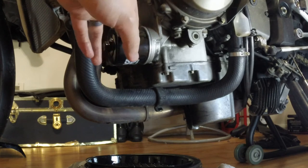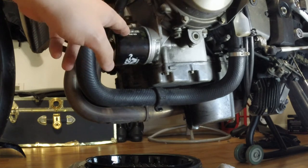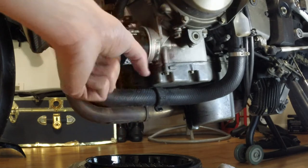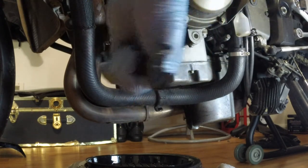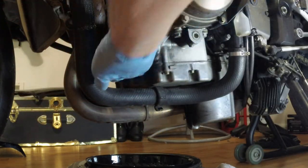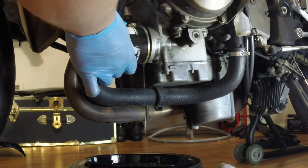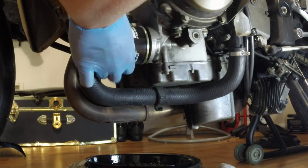For oil filters, I like to use the K&N brand — part number KN204 for inquiring minds. That's what fits the ZX-6R. I like the K&N just because it's got this little bolt on the back and it's a 17mm bolt, which makes taking this thing off so easy. You don't need one of those annoying wrench things that like crushes the oil filter while you take it off. The only bad part is the radiator hose gets in the way so you've got to use just a wrench — I lucked out because I got these sweet Craftsman with a little clicker, so you can just socket it off pretty easily. And there comes what's inside the oil filter. Most cars just have it sit up underneath and you pop it off and nothing really spills out, but not this one — not this one at all.